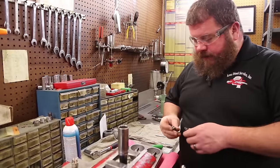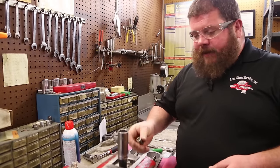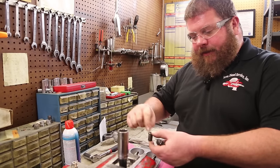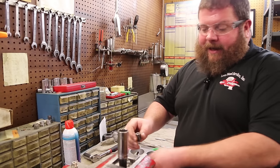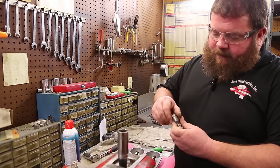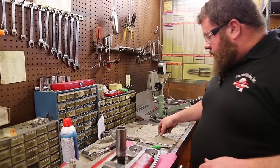Struggle bus just left. We got all these back together. We actually had to have two guys on it, put it in the vise, get everything lined up. One guy holding down the spring retainer, aligning the pintle with the larger hole off to the side, and another guy in the bottom pushing the pintle up. There was some colorful language, but nothing was hurt. Reassembled the nozzle itself, put them back in the injectors.